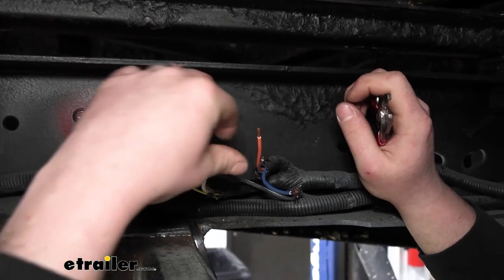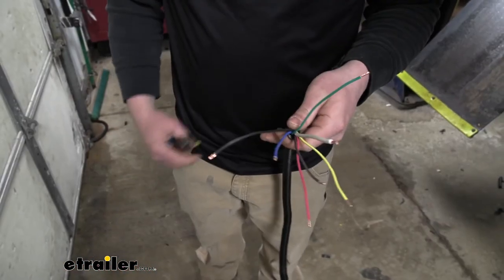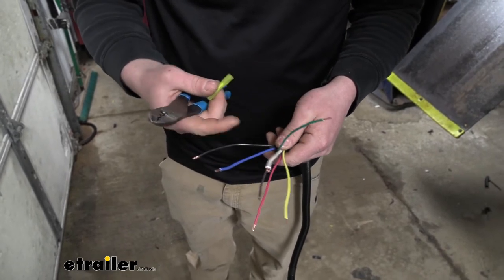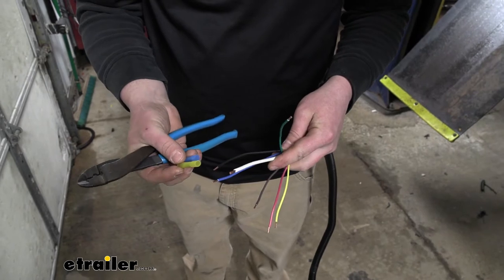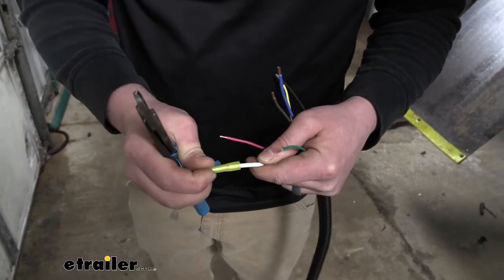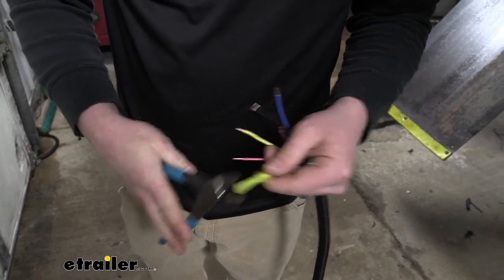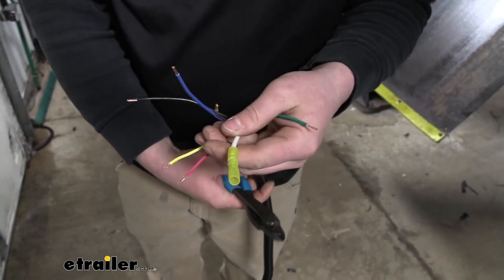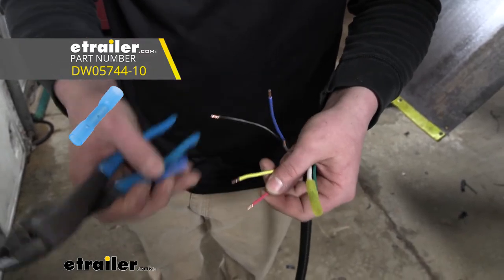Now that this factory wiring is all prepared, we can grab our new seven-way and get that ready to make everything connected. I went ahead and stripped back the insulation a little bit on each end. I am using heat shrink butt connectors — the ones that come in the kit will work just fine, but these give us a little more protection and you can find them here at eTrailer. The butt connector just simply slides over one end and we'll crimp it down. It's easier to do this side of the seven-way connector first so these are already attached, then once we go underneath the vehicle you can simply just connect the two together.